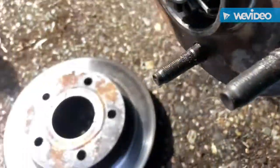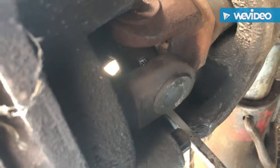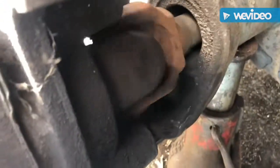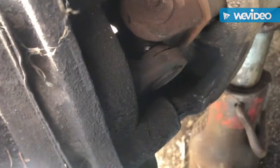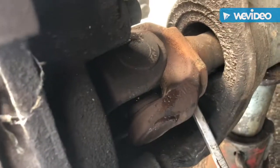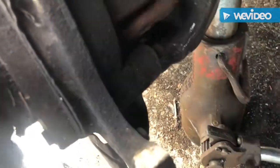All right, yeah, so you can see now I took off the disc and look at this play, guys. Listen to that. Now, when I had the wheel on, I didn't hear that. I mean, I was feeling a little bit, but no noise. And you can see now, I did spray a week ago. I sprayed some WD-40 on the bolts and stuff, so it kind of looks a little better than it was. You can hear it, but it still spins kind of freely.